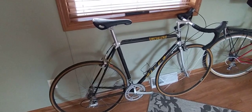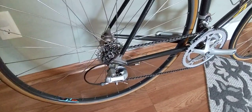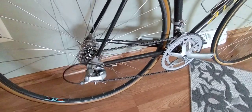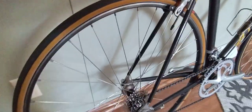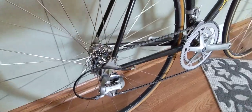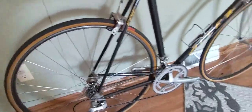Well, that didn't go as planned. So I ended up putting on a nine speed rear cassette, removed one of the cogs, and went with a nine speed chain. With the spacing, I did not have to switch out my rear derailleur and I still have the 1055 rear hub. Don't mind the little tape in there — I use a Garmin setup and that helps the Garmin sit in there.